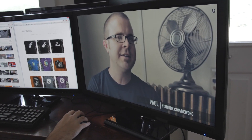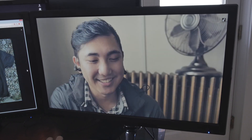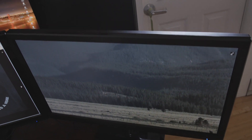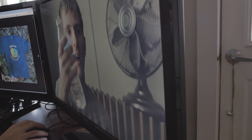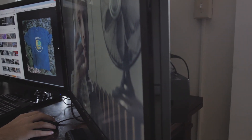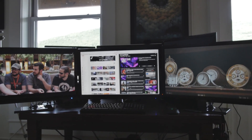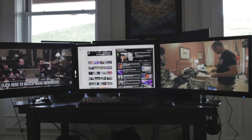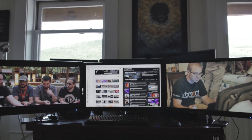The one on the right is a little bit cheaper but also has an HDMI, so you get more ports. That adds a tiny, tiny bit of latency — nothing that I actually noticed with my physical eye playing video games or anything — but some people have reported there's more latency. I didn't notice anything. This one is an AHVA panel. It's similar to IPS; it's vertical alignment, a different technology slightly. It's going to be a lot better than a TN panel as far as viewing angles, color shift, and all that sort of thing, but it's not quite as good as a TN panel when it comes to speed. They're advertising a four-millisecond response time, so that's really good. It's somewhere in between an IPS and a TN panel, but the AHVA is slightly more washed out — really, it looks way better than a TN panel, and if you're on an extreme budget, it is priced nicely.